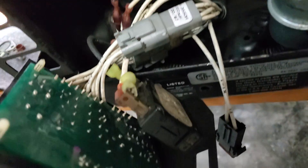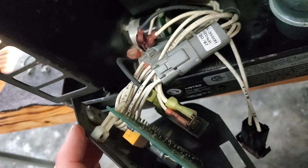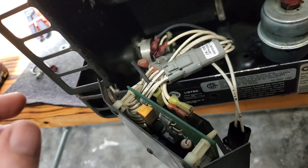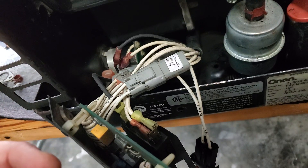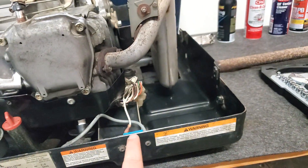You've got two wiring harness connectors and 120 volts out. The wiring connectors just disconnect — you can pull them apart. The 120 volts here is connected via a 25-amp breaker on the outside, accessible without taking the case off. The wiring harnesses go to various places in the generator: one is your remote start input from inside your coach, and the output is your 120 volts out.